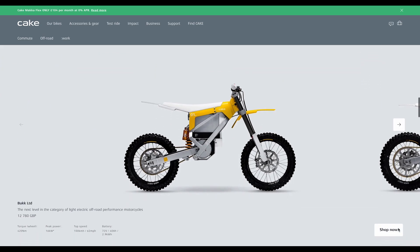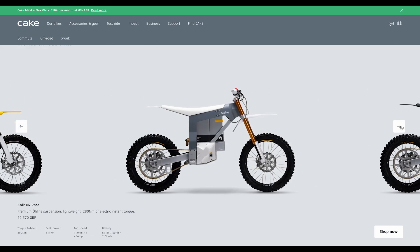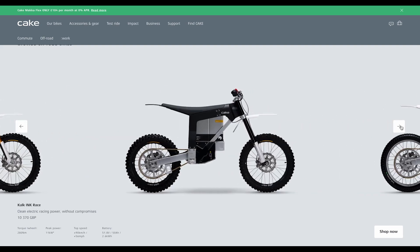In addition, the Kalk has three braking modes which allow for various levels of regeneration or simulated engine braking. Freewheel mode 1 provides no regeneration or simulated engine braking. The two-stroke mode has medium simulated engine braking and regeneration, and the four-stroke mode rides nearly like a petrol motorcycle with simulated engine braking and the most available regeneration.